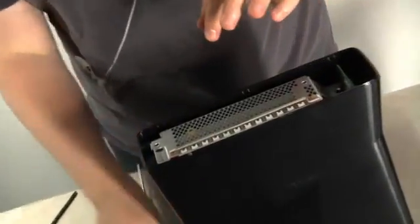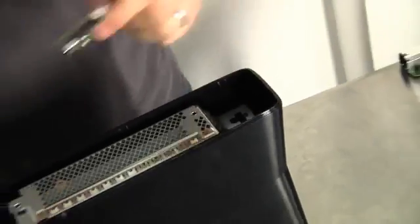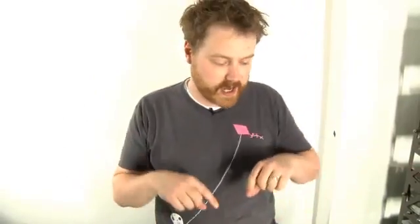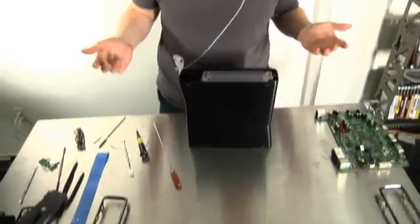Next thing I need to do is take the Wi-Fi adapter off. This is 802.11n, ladies and gentlemen. We just tested this out, still kind of semi-unassembled with the Giant Bomb guys to see if the new 360 would work without the wireless adapter — it does, it boots up. The menu options for the wireless stuff are missing, which probably means Microsoft has the option of updating this without the wireless at some point in the future. Let's continue on our horrible journey of disassembly.